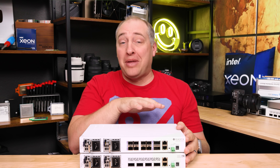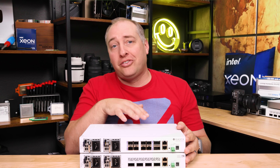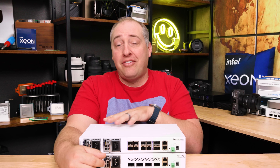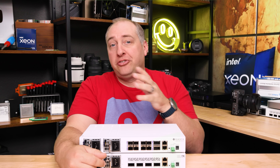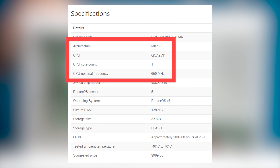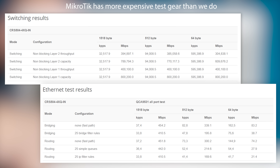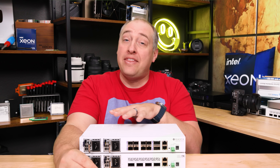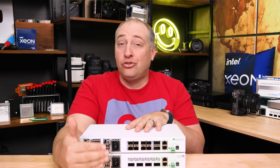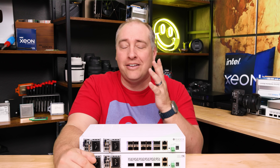Let's talk about the performance of the switch. If you're just passing basic traffic, you can totally get a total of 800 gigabits — 400 in each direction across all of the ports. This is a non-blocking switch and it definitely has enough bandwidth to do that. But something really important: if you don't have a hardware offload path and you're doing bridging, routing, or something like that in this switch, you're going to go over that single-core 650 MHz MIPS processor, and the performance is not good. MikroTik's own vendor numbers show they're not even getting to half a gigabit per second doing that. That is super important, because you're just never going to do routing at 25 or 100 gigabit speeds on a single 650 MHz MIPS core.